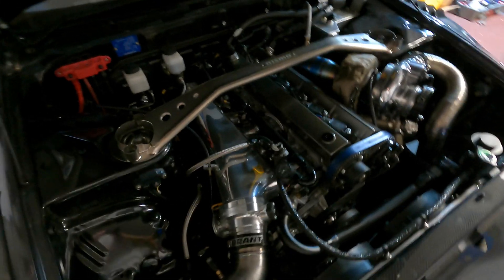I had some issues a long time ago with a previous RB25 that we were trying to tune. It didn't have a fuel pulse damper and we had this flat spot in the fueling which would go ridiculously lean — I think it was right around 4500-4600 RPM — and once you pushed through that, things would go back to normal. We tried to tune it out, tried to add fuel, but there was nothing we could do at all.